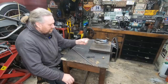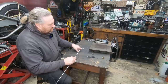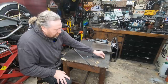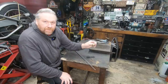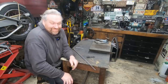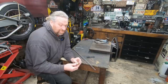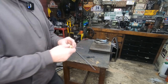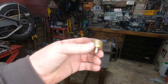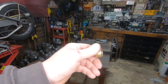So we've got that, and we've got this for the front part that goes onto the brake lever. I'll have a nut on there first — we've got a brass nut — and then that clevis, or whatever you want to call them, that'll be on the front. And we've got this lump of brass here which I'm going to turn into something that resembles some sort of wing nut. I know you can go and buy them, but I'm going to make one. I'm going to get the grinder on this and do some sort of shape out of it. It is really roughed out on the lathe — my lathe's a bit clunky, but it's good enough for what we want here. We're going to put a bit of shape into that, and that'll be the adjuster right on the back there.